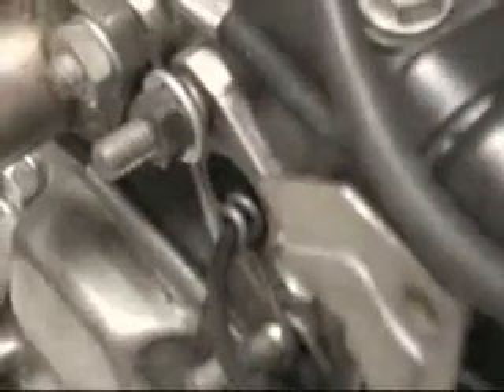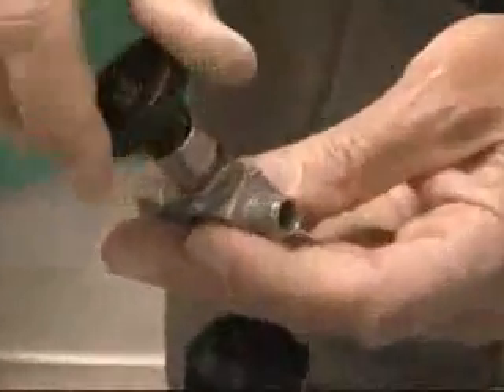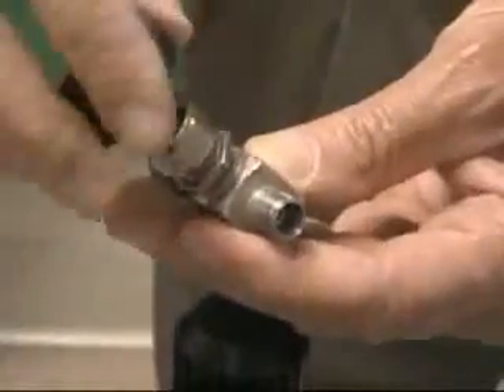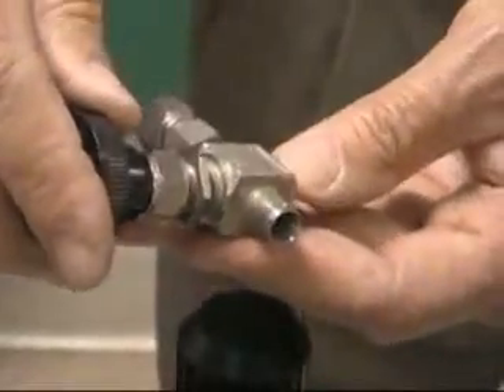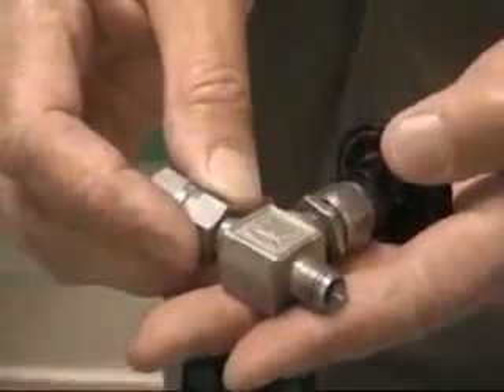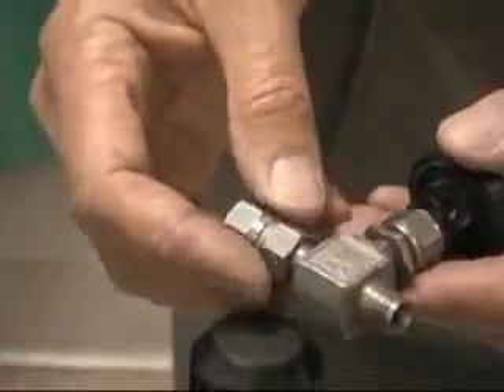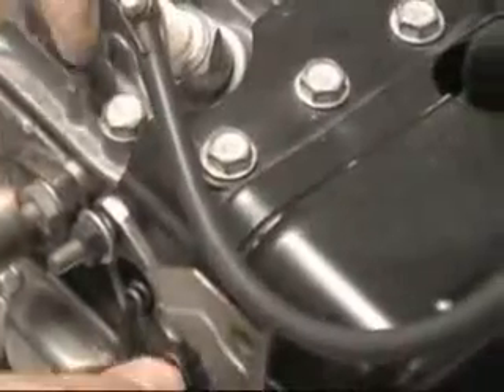We're doing the engine power control with a metering valve, which is a needle-type valve common to the instrumentation industry where it would be used for controlling the flow of nitrogen, oxygen, or hydrogen in a lab. It's sized for delivery on an eighth-inch tube, and we then cut it down to an even smaller diameter at the point of injecting.